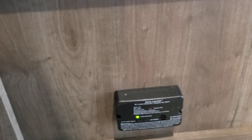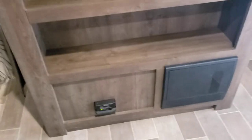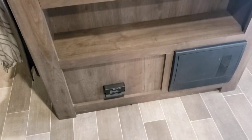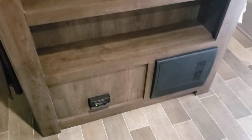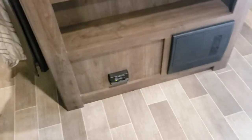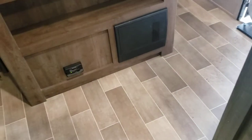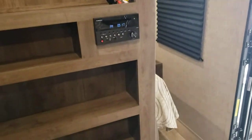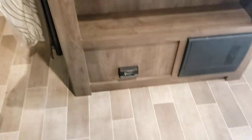To the left of that, RV carbon monoxide and propane gas alarm — that's hardwired to the 12-volt system, so there are no batteries to worry about changing. However, they will give low voltage chirps if your battery on the front is dying while you're not plugged in, because it's not getting enough voltage to operate. That and your radio always use power even if you have all your lights off and it's unplugged — like radio memory.